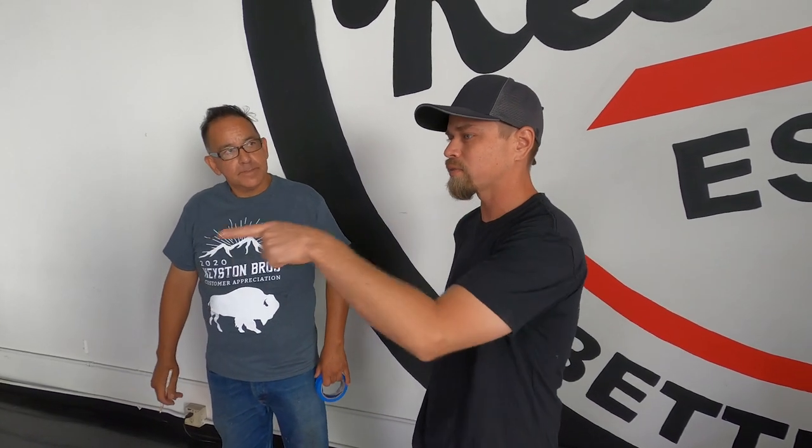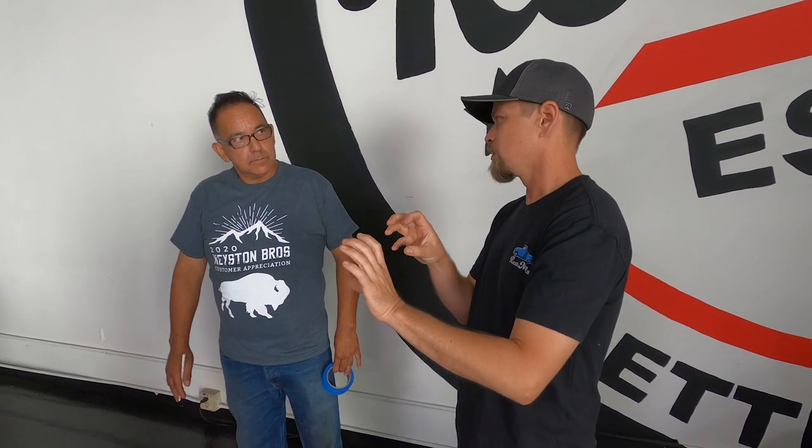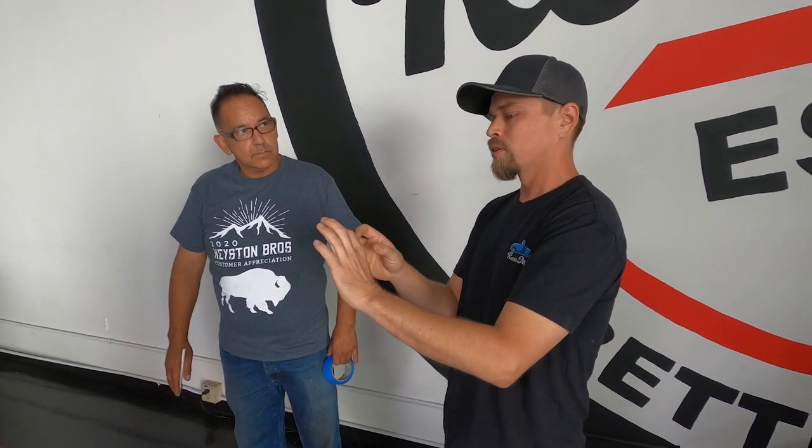And I've also seen, if these door panels get too thick, even if we do want to do the manual cranks, they sell shaft extenders now. So if our shaft doesn't protrude far enough with this door panel, we can put a little extender on there and that'll set us up at the right height. You don't happen to have the old door panels, do you? Yeah.